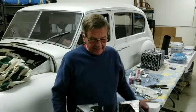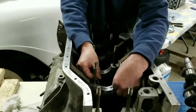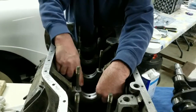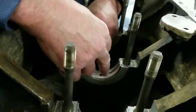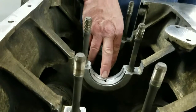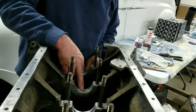We're going to fit the crankshaft in the V8 engine and just want to point out a few things. The bearings go in and they're a snug fit — you put the pick-up point there, the cut-out there, then push them down and make sure they're flush on either side. We've got one here where the hole has probably been put in the wrong spot — you can see those holes are off a bit, but there's no problem. The groove and the oil feed will get plenty of oil in there.